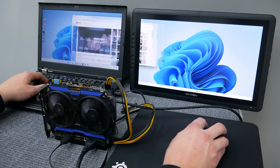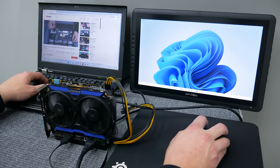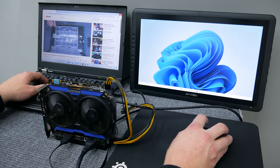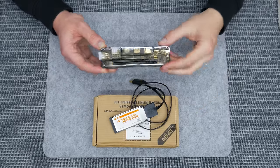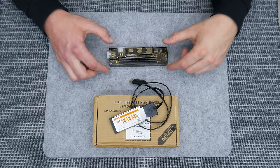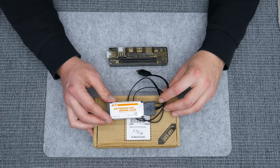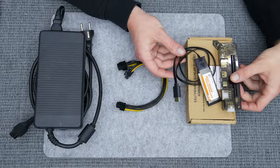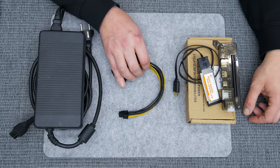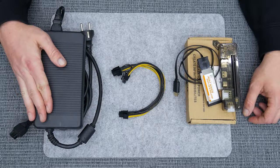On this laptop, we're gonna connect a desktop GPU, or aka eGPU. I have done this because I really want to experiment and play with the laptop and do something different. Connecting a GPU can go in two different combinations. The basic device is EXP-GDC. The connection goes over Express Card, Mini PCI Express or NGFF. The power supply can go over EXP-GDC, where we can use a 6+8 pin cable as maximum. And in this case, we need an 8-pin Dell DA2 power adapter.